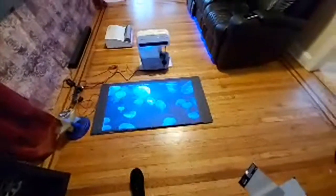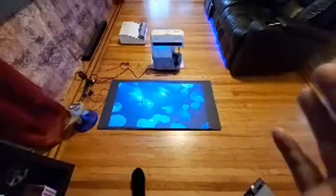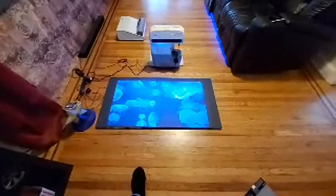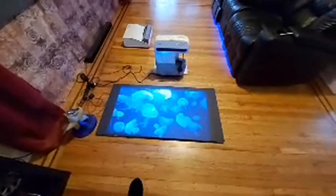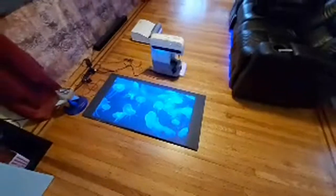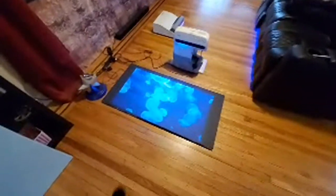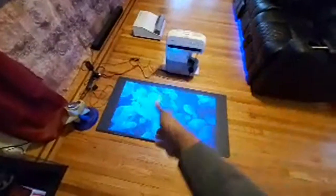But if you have a projector and those settings are pushed all the way down, then chances are you did that yourself. So that's why when you send us pictures, show us the settings in the projector. They don't realize that we know this from the door because we've done these demonstrations on projectors before. Somebody says, well, I bought the projector that way. No, it's virtually impossible. I can buy a brand new projector, turn it on, and you'll see all the settings are at 50.